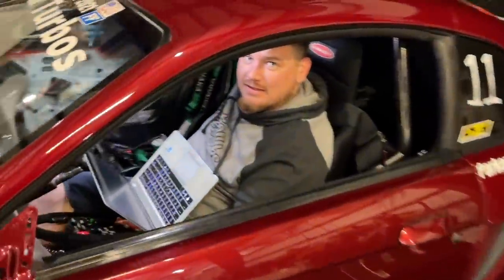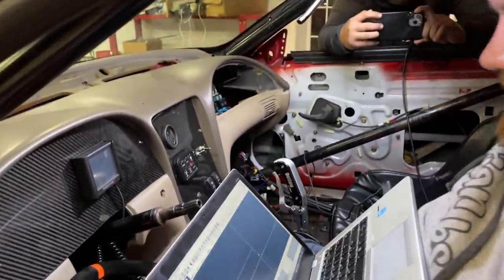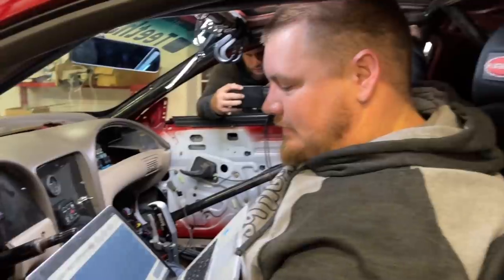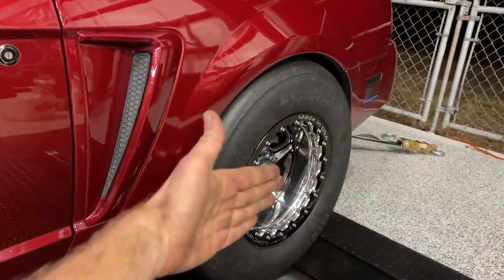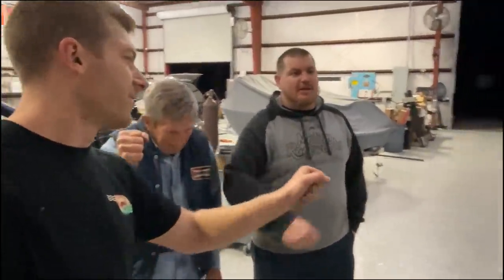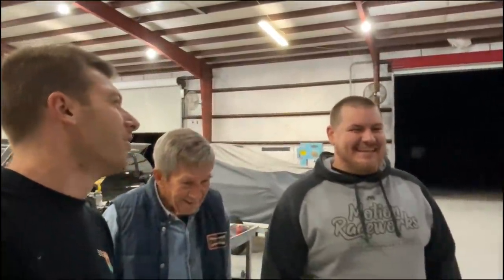What is that — a BS85 on that thing? It's an 88-103. Oh, I thought it was an 85. Either way that thing's making some good power. 14 and a half pounds of boost — it's not pushing through the converter, is it? No, you hear it — it's coupling. It flashes like it's supposed to and then couples, pulls it down, then pulls again. Garrett and I were worried about that. But at 14 and a half pounds, all the converter is saying is 'give me more power.' Sam was noticing we're getting a little wobble with this axle, so we're gonna take that wheel off and make sure it's safe. Let's call that a successful dyno run!